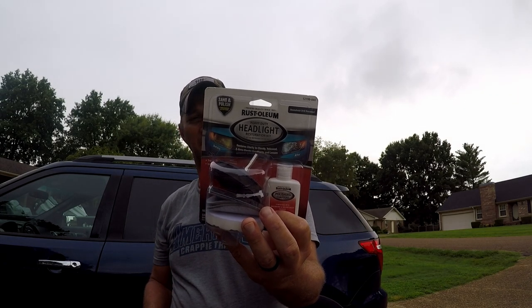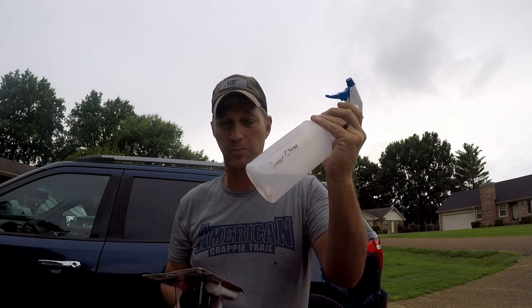While putting my kill guard on I noticed very light scratches down the edge that look like they can just be wet-sanded out. I picked up a headlight restoration kit at Walmart — it has 1500 and 2000 grit discs you can use on a regular cordless drill. I stopped what I was doing to test it on the scratches before I get the kill guard back on. For wet sanding you need water or some soap — I already had diluted Super Clean in the garage, so I grabbed that along with my headlight restoration kit.